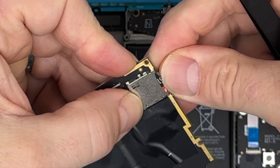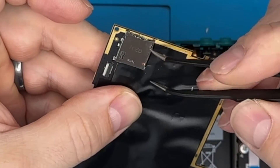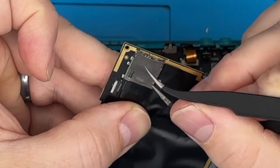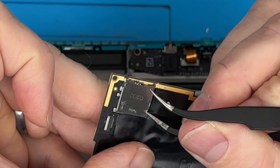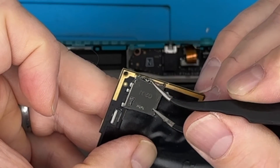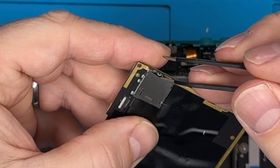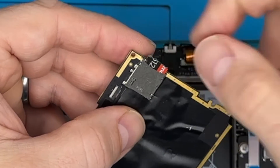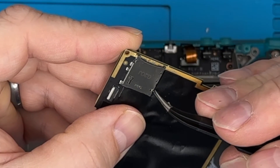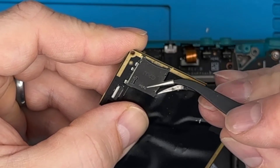So you put the card in, push it in there, and you'll see it pushes out a bit — that spring pushes out. If you get your tweezers in there and push it up like that, that spring can get stuck out. You can see that spring there — it's stuck out. So even though we can get the SD card out, the last thing we want to do is make sure that spring is relocated back in. Just give that spring a nudge back in; it's come out and down. Knock it up and it springs back into place.